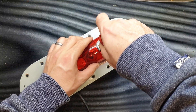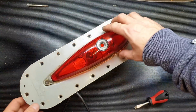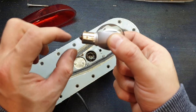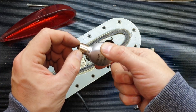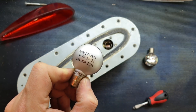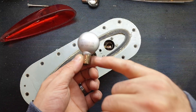Okay, so let's take it apart and show you how it works. There's a single long screw here that holds the lens on - 10 or 15 turns - and it just comes out, then we just lift it off from the front and pull it out the back. Now the bulbs here - they've cooled down sufficiently. They are biased; they've got a contact stud near the cap and one about a third of the way up, so you can only put them in one way. These are Grimes A7079B, 40 watts at 28 volts DC.